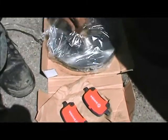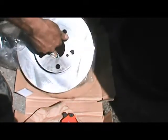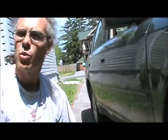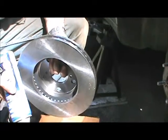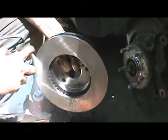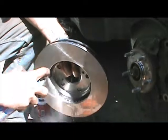Now we've got our new brake rotor. When they package them they wrap them in plastic most of the time — that's to keep moisture away so they can't rust. They should always be stored flat, never on their edge. There's often an oily coating on them which is part of the machining process and a preserving oil they leave on the rotors so that while they're in storage they don't rust. You need to get rid of that. So get your brake cleaner out again and take special care to wash the braking surface — especially the part where the pads actually touch.